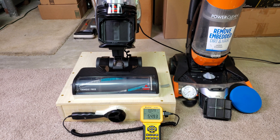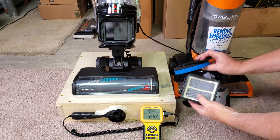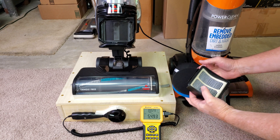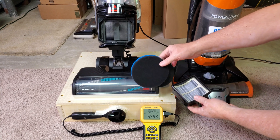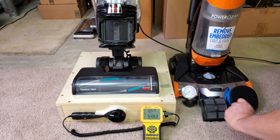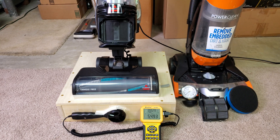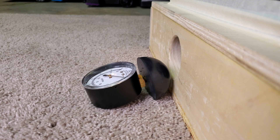All right, I think that's all the measurements — more measurements than you probably want to know. So what I'm seeing without getting a calculator out is that because all these filters are unbelievably clean, for the most part these don't really suck down a whole lot of CFM at all, so that's good. Of course when they get clogged, I imagine the CFM will drop fairly significantly. I'm going to start this machine in low carpet mode — that's maximum airflow and suction, all filters in, brush roll spinning — and then gradually go down to plush carpet, which will reduce the suction.